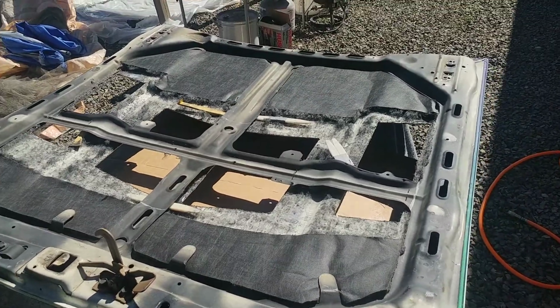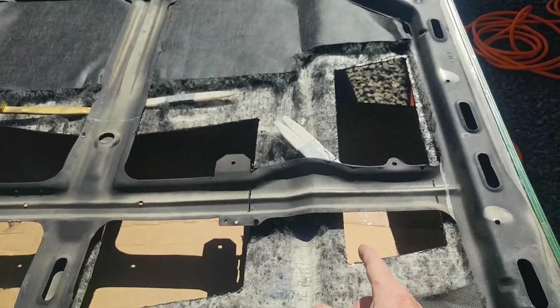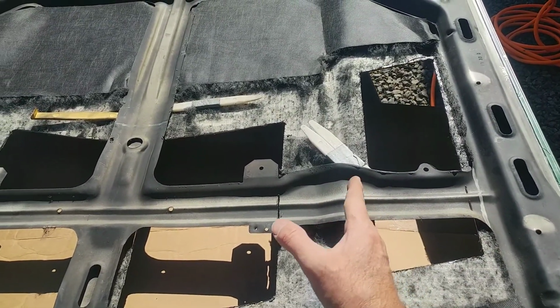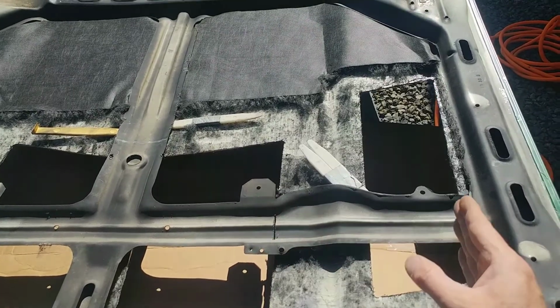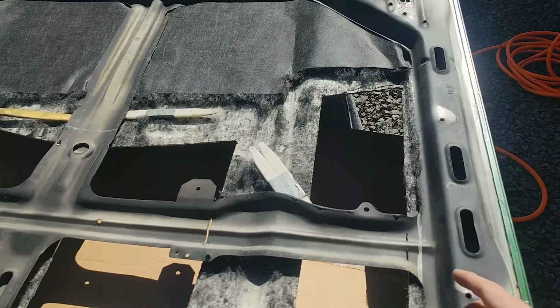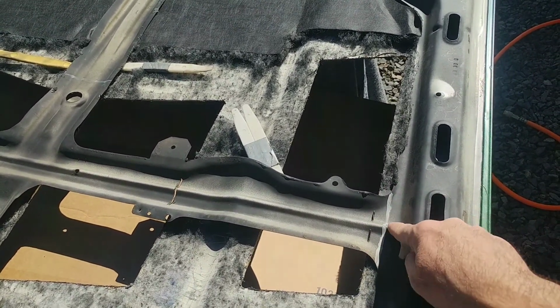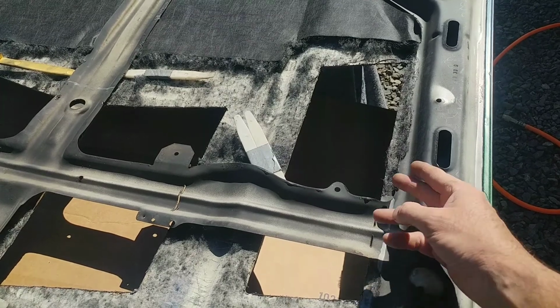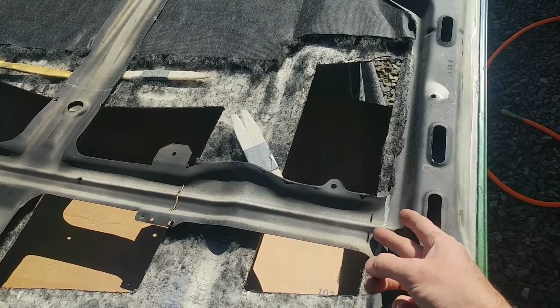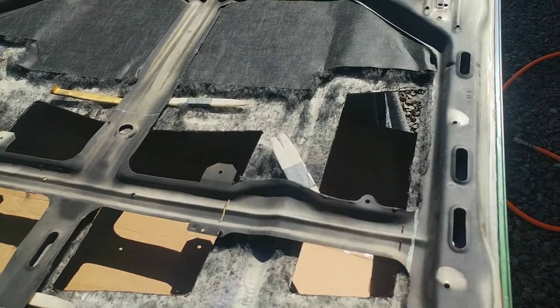Now with the hood flipped over, you can clearly see where your side louvers need to be recessed at. So again, we're going to do 1 inch to the side, which would be roughly in here, 1 inch to the side, which will be roughly right about where that white line is. If you go anything further, what you're going to start cutting into is the base here where it touches, and I want this structure, so I'm just going to cut right here where it's gapped, where it kind of goes up and over. So cut that, cut that.